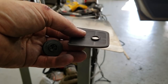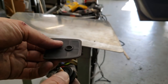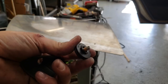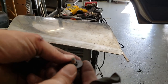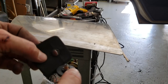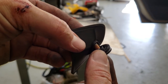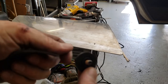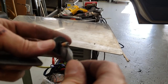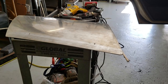This is the gasket that goes between the hinge and the glass — in our case, this aluminum panel. This goes through the panel like so. You can see there's that little raised area, so I got a drill bit that matches that diameter so this whole thing will lock in there.